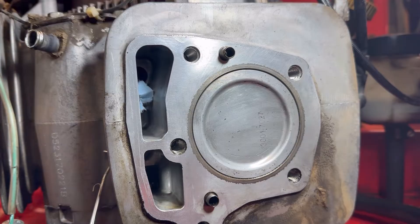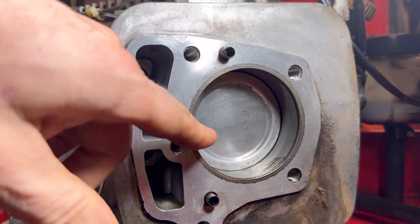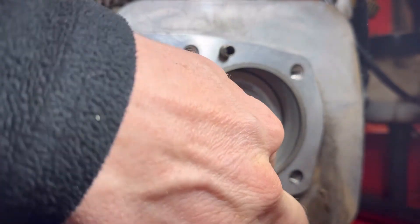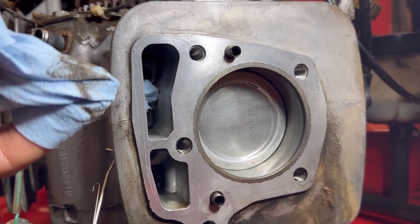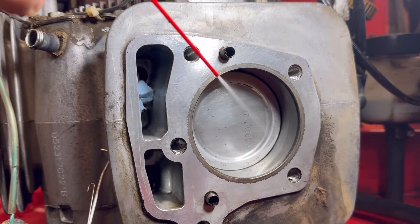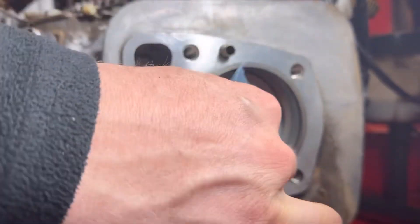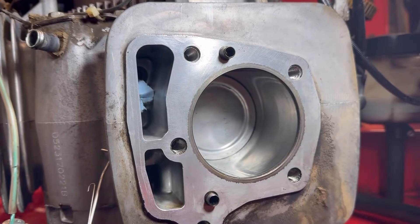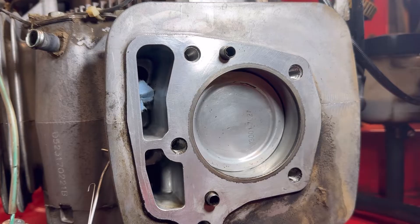Now we're not done yet. Next, we need to draw the piston down into the cylinder, because as you can see, a lot of that stuff is along the edge. We want to go ahead and first just wipe it off and get any gunk out of there. Then hit it with a little carb cleaner around the edge. Now we're pretty clean — so let it go all the way down, clean it in there a little more, bring it all the way up. Do another stroke so it picks up anything else, bring it back down and clean it again. Go ahead and give it a wipe — just a tiny bit of stuff left.